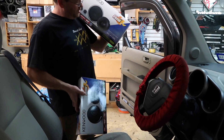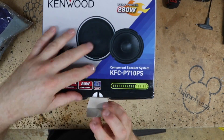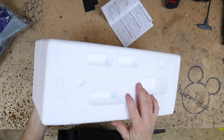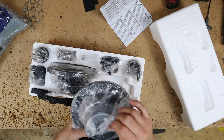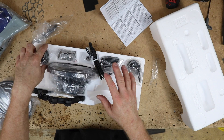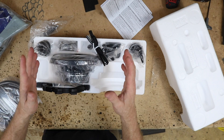We're going to go ahead with some Kenwood six-and-a-half speakers for the back and some components up front. These are a mid-priced speaker. What's cool about them is in this car the tweeter is in the A-pillar and the mid-range is on the door. If this had a big external crossover network, one of those big boxes, we'd have to mount that somewhere and run outputs separately for the mid-range and tweeter.